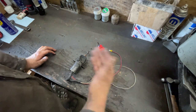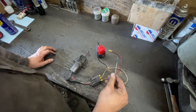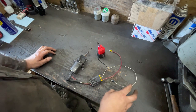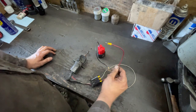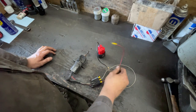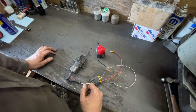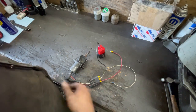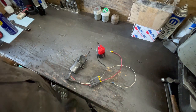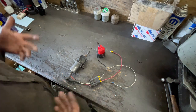On the power side, if you're tapping into the starter signal wire, you don't have to put a fuse in there because it's already fused — as long as it's wired properly. If you want to put a relay in, I've always used a 20-amp fuse on it. For relays, I usually use 30–40 amp relays for everything, just because I'd rather have a slightly bigger relay.